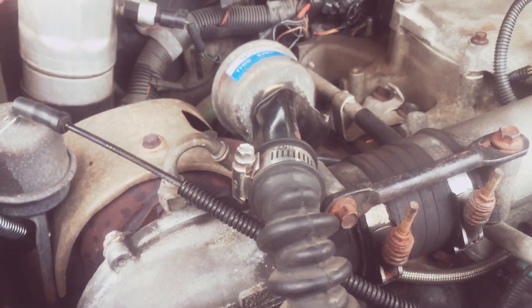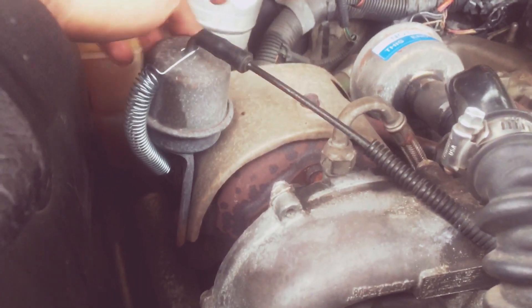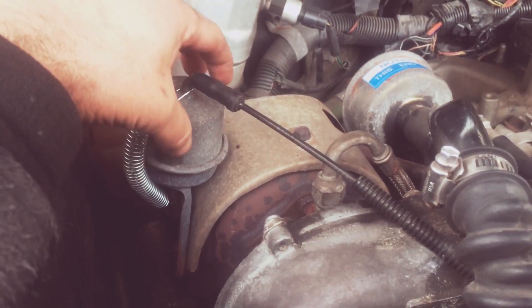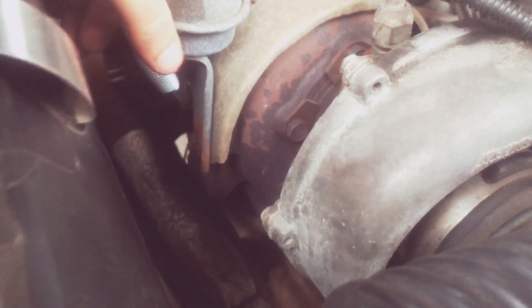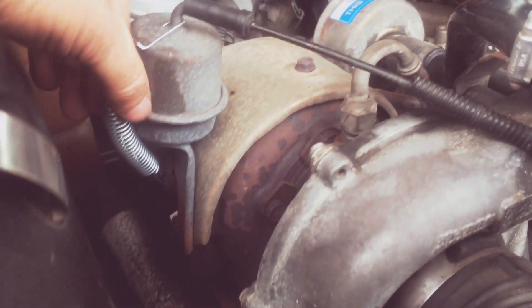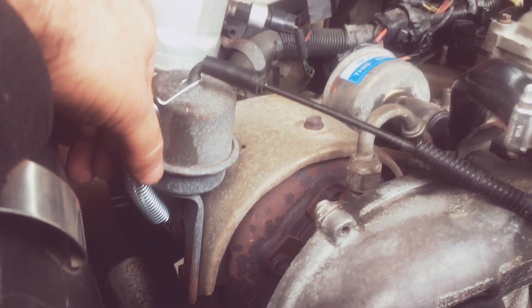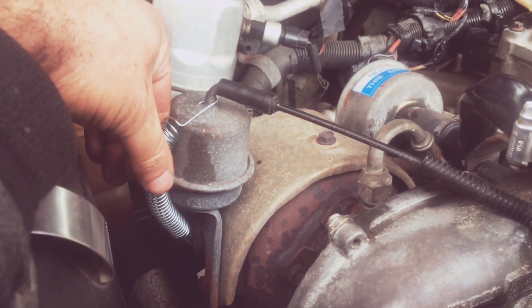Since the vacuum pump is not working — and there are probably a million ways to deal with this — some people cut it open and finagle with it to adjust how much pressure you put on that little lever. What I did was I just went to the auto parts store and picked up this little spring here. What it does is this spring holds that lever up, and by driving I can see that it holds up to about five PSI.